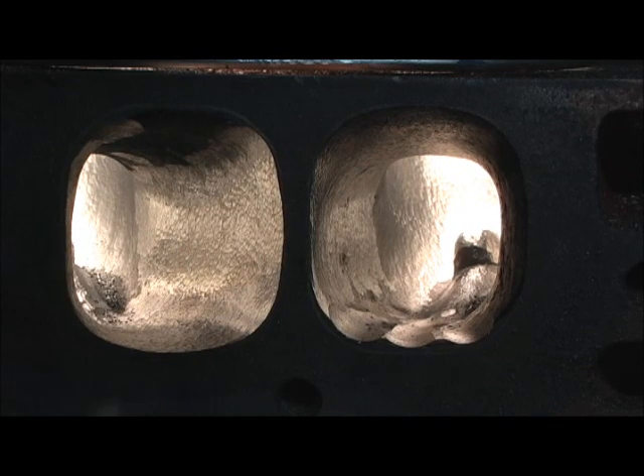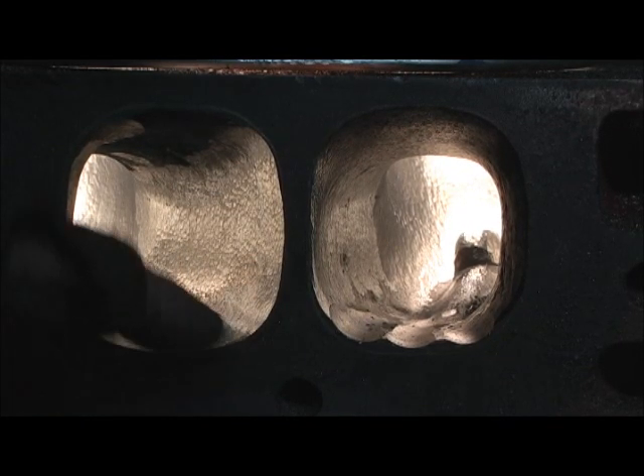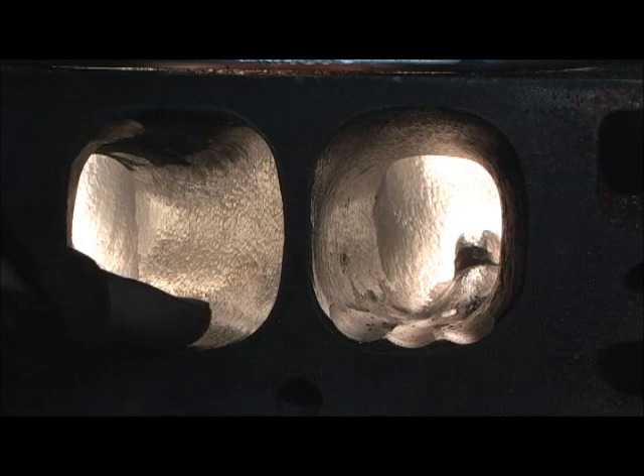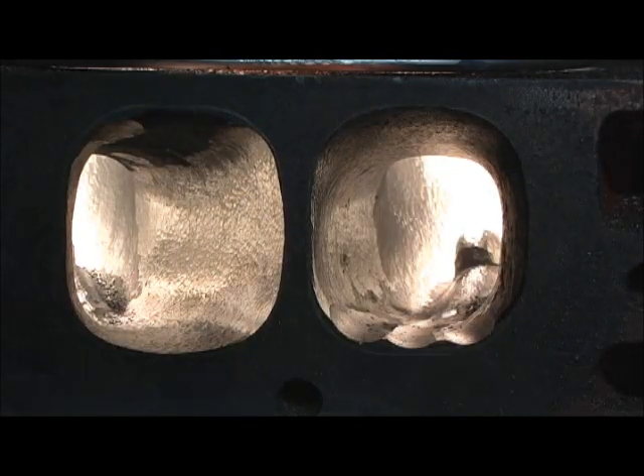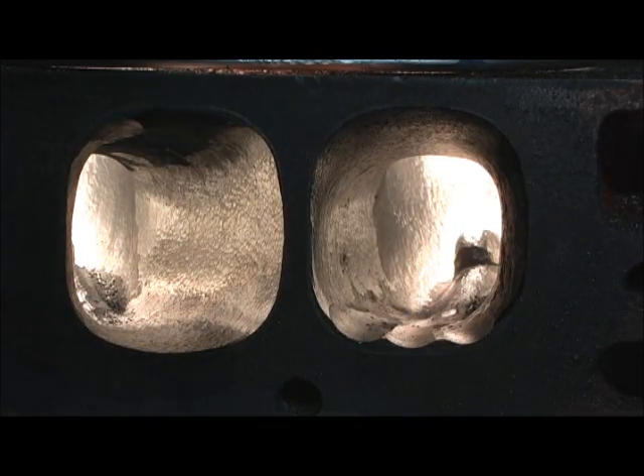Look how nice. Now when you look at this line, the port is going straight back. There ain't no port coming up and humping like a big giant funnel — because I don't do funnels here. That's what it takes in your trenching. The reason I do a center cut on this compared to small block heads is there's just not enough meat on the small block. When you get into the big block stuff, the cross-sectional area is so much greater that a third trench has to be dug. I even do it on the sides and sometimes on the bottoms up to a point.